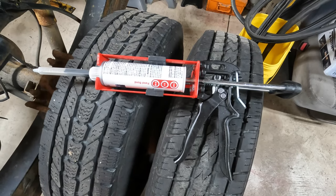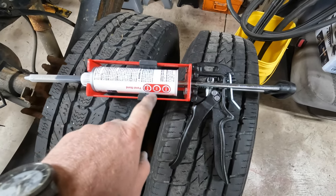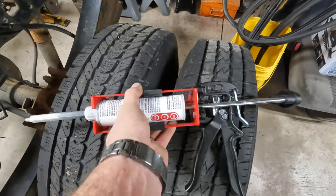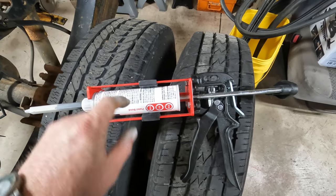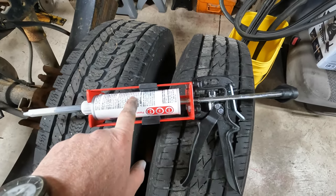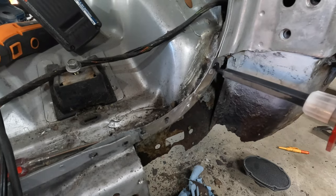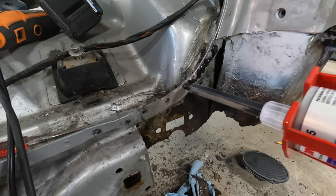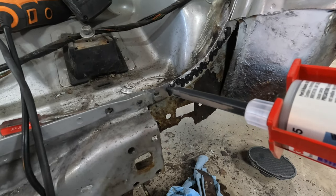The glue we're going to use is made by 3M — it is 3M Panel Bond glue. I will put a link down below. The glue is separate from the gun; the gun is more like a caulking tube gun, but it's basically a two-part epoxy. There are very small glass beads inside, and what that does is keep everything gapped correctly, because this glue needs a little bit of a gap — if you squeezed it all out, that would be bad. The manufacturer put these tiny glass beads inside so that when you clamp and get everything tight, it is appropriately gapped. This glue works best on bare metal, so make sure you sand all the paint and primer off any pieces you're gluing together. The nozzle is self-mixing, so it is absolutely mixing the two parts as you squeeze it out of the gun.